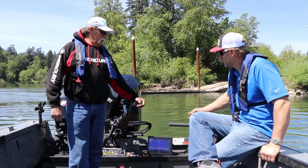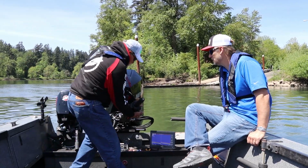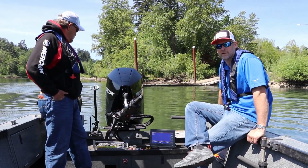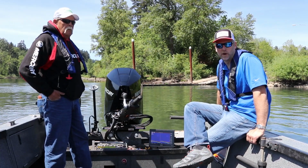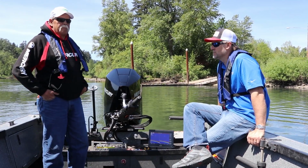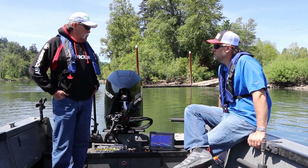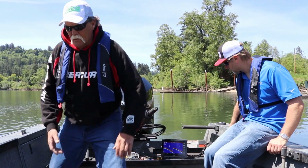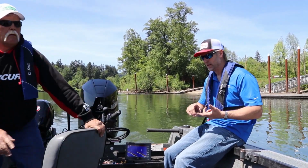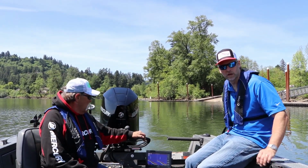With the Mercury 300 here, these have a proprietary power tiller on it that's built for it. So if you hit something, it's not going to throw you off track, because controlling a motor like this without power steering is a lot like having the tiger by the tail. Now with power steering, it makes control of a motor like this like you're driving a 15-footer. It's huge, and it's not wearing you out and beating you up throughout the day. So with that, why don't we put her on plane and let's check the RPMs. This has got a Mercury SC1000 system tach on it, which gives you your hours, your temperature, trim, a whole host of other functions, and it's a really nice piece of equipment to have with your Mercury engine.